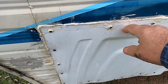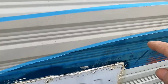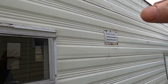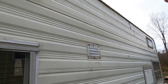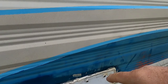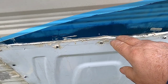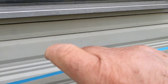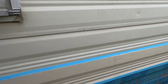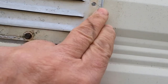This was the opening that I sealed off with metal from a dryer — or washer, I'm not sure where it came from. Up on the roof there was one of those domes; I kept one and closed the other off by putting a piece of this metal underneath. I used plenty of caulking, then the roof sealer, and even put Flex Seal on top of that. No water came in whatsoever.